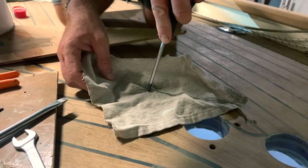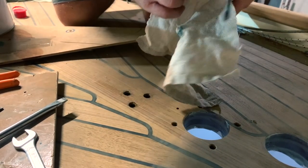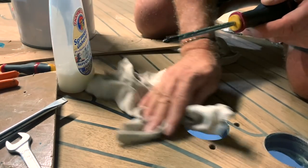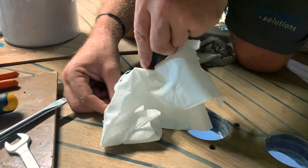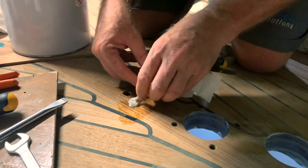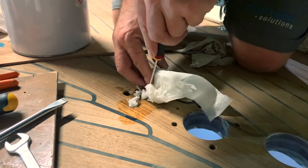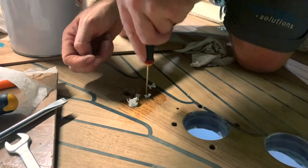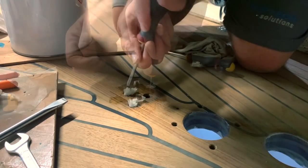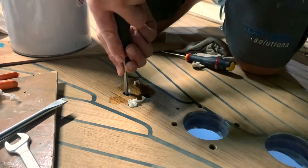You will ask what I'm doing now — I'm completely cleaning inside the holes. I'm removing all the grease with some products because butyl and grease don't work together — it doesn't make a watertight seal. So I spend half an hour with acetone and degreaser, everything to be sure that not a single drop of grease is inside the hole where the chain plate bolts pass through. You can see all my effort to remove all the grease from the holes.